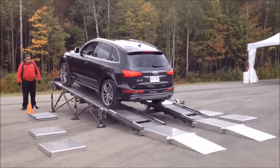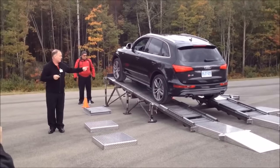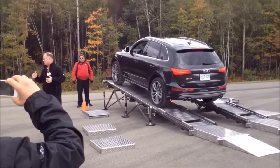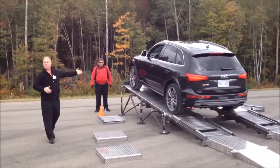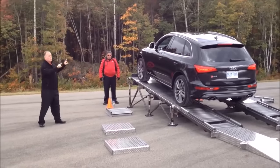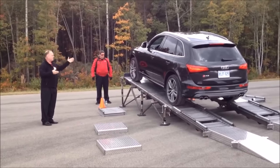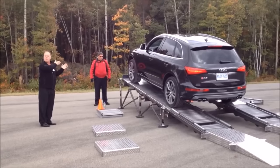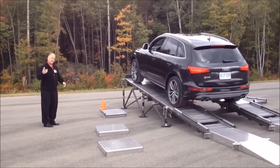So the mechanical center locking diff, is it effective? Absolutely. And you saw the rear wheel had to do 3-4 spins, and we got lockup, and we started walking the vehicle up, front wheel drive. So from a north-south, easy to walk, right? It's 40-60, but easy to go up to 70-85, and we can play with that all day long. Now let's make it more challenging.